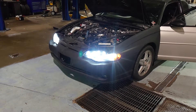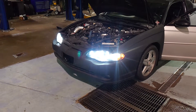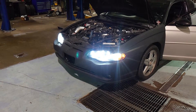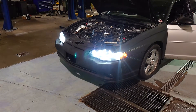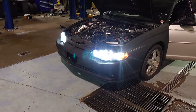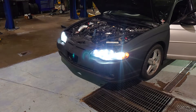So does spraying water on your intercooler help? Maybe. The engine coolant went down and the intake air temp went down. I have two water sprayers on my intercooler and two on the radiator, so that drop might just be from the radiator because the coolant's running colder — meaning the intake air temp from heat soak in the engine is probably going to go down too. My next test will probably need to remove the intercooler water sprayers and see if I get the same results.